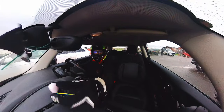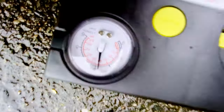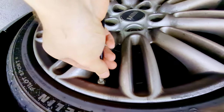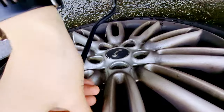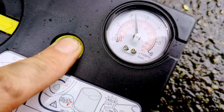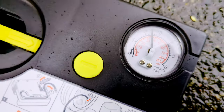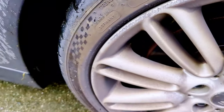That were an interesting one. Just checking the pressures for the first time today after lunch. End of that session, 40 psi. Should have dropped these earlier, really. I think they're wearing fine, but the thing is, I don't know how you let air out, if you can even. I wonder if that little yellow button in the middle does it. Oh, yeah. So if we aim for mid 35, 2.2 bar actually, rather than the 40 we were running, we might see them front grip issues start to go away.